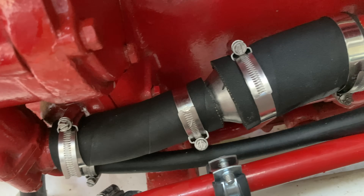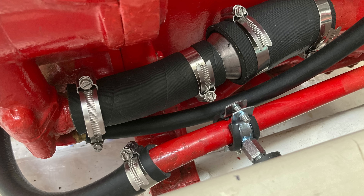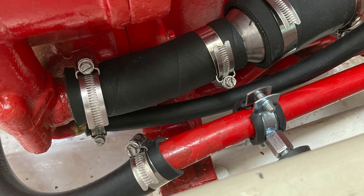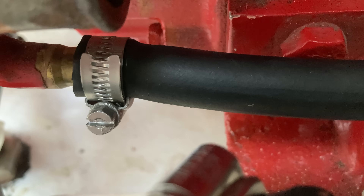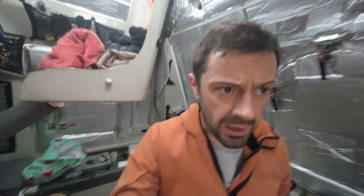You can see another hose hiding behind, and this again illustrated how inconsistent hose tail connections have caused headaches. I couldn't justify a reducer here, but even with heating, I couldn't get the hose as far over the lip as the old softer hose had managed. Still, there's just enough for the Jubilee clip to get a full grip over the metal beneath. I couldn't use an O-clip as I couldn't get access with the O-clip tool. I'm quite glad that I'm working inside today.